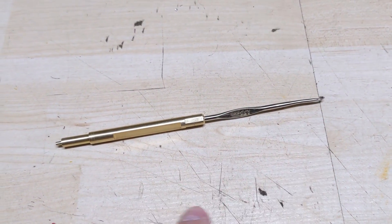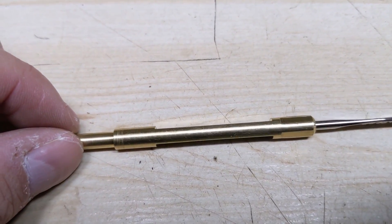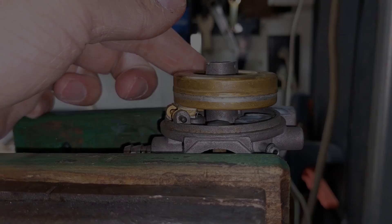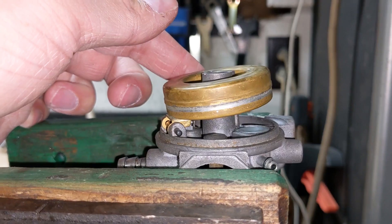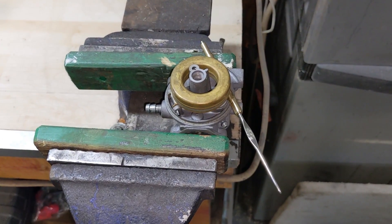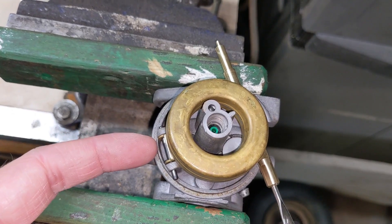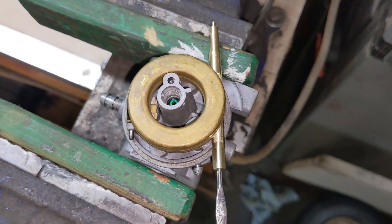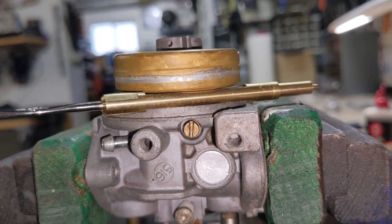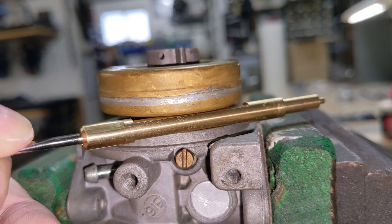Now there's actually a third thing this carburetor tool can do. Coming to the handle, you're going to notice there are two machined flat spots on the handle. Those two flat spots are what we're going to use to level the float. Setting the float height determines when your needle valve opens and closes, which means it determines when your carb lets fuel in and when it shuts fuel flow off. With the fuel bowl gasket or o-ring off the carburetor, you take the machined edges and set them up on the front of the carburetor and look for the float to just barely make contact. Our float is now set to the proper height.